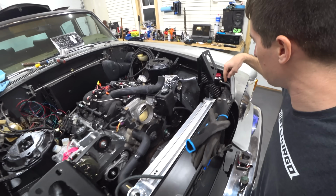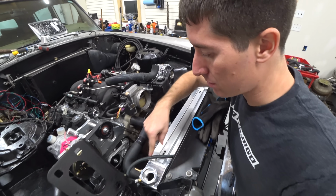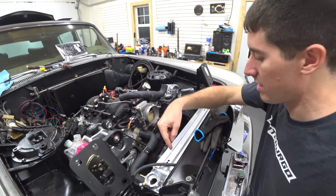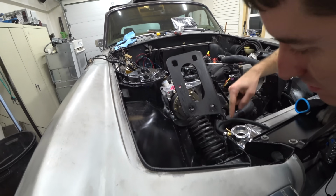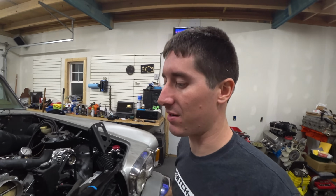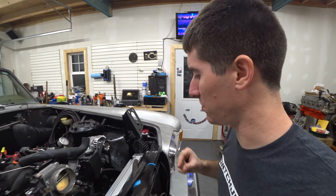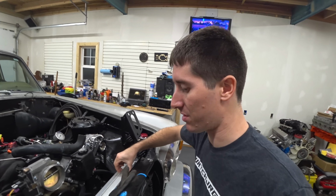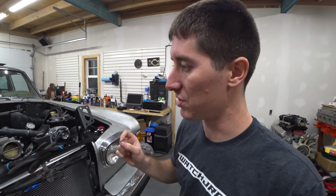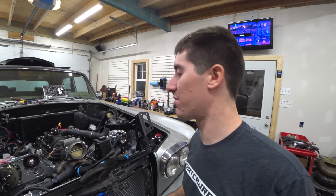And we just went ahead and put on our hose. We're just using fuel line because fuel line's crazy strong anyway for the overflow. And that's just a 1/4-inch hose, and it's hidden underneath this piece here. We had to build a little custom brass fitting that wasn't supposed to fit in there. We had to drill that out a little bit and make it work. So we've got a little bit more to do on the radiator. Tomorrow I'm going to drill out this hollow aluminum section here and bolt the fan shroud on, because I don't want to do it with self-tapping screws. We want to do it right. So we want it to be really good and solid. So 4 more bolts going in the fan shroud, and that should wrap that up.